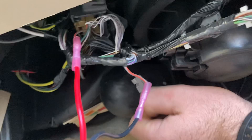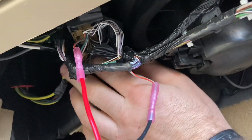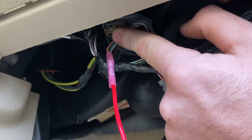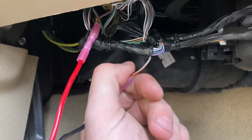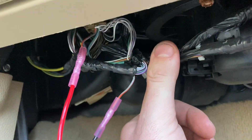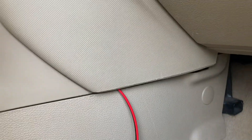The way that we do this is down here in the passenger footwell — we are looking at the underside of the glove box right now. This piece here is the 4x4 module; it controls the 4x4 functions and some other things. The brown connector, which is closest to the passenger seat, has a bunch of wires coming out of it, and coming out of it is this gray wire with an orange stripe on it. This is the wire that you're going to want. You'll need to clip some of the electrical tape away in order to gain access to it, and then you simply clip it, strip the ends, and splice on some wire, and you can run it to anywhere in the cab that you like.